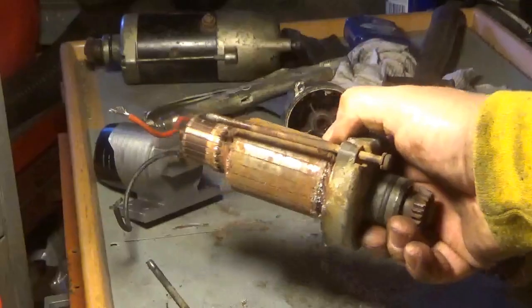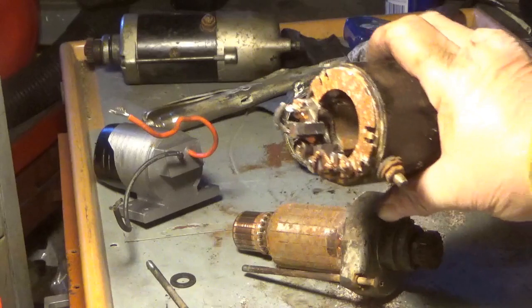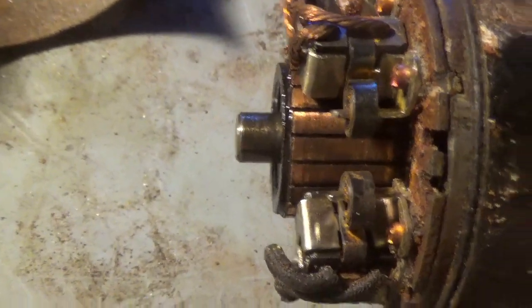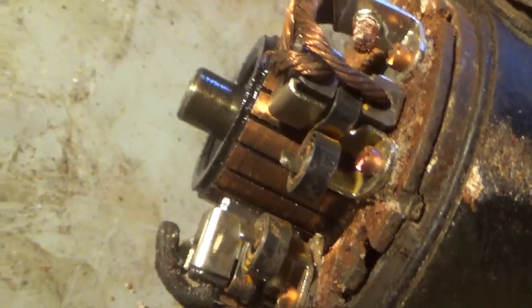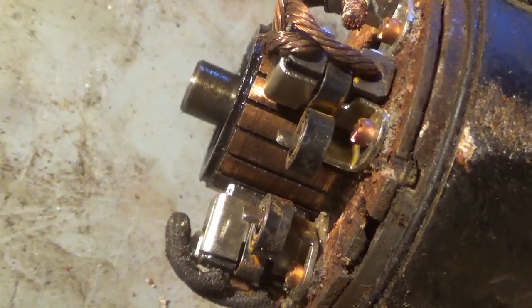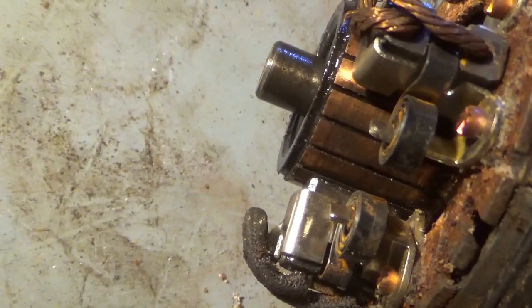I took this second one apart and you can see it is quite nasty. Let's clean it up — maybe we'll be two for two. The brushes look like they're in good shape and they're even moving. On closer inspection these brushes look about new. When you push the armature all the way in it kind of hangs up a little bit. It appears I have a defect, so I'm going to pop these brushes out and see if there's something wrong — I think it's grabbing where the brushes slide along the armature.